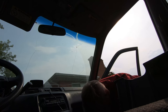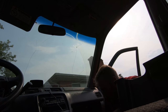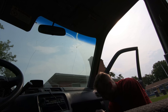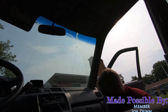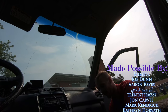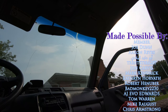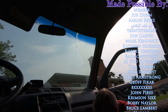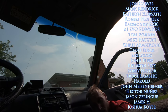That's playing way stronger. That just made me realize that's the best way to clean out the air filter housing area — just turn the blower motor on. That is definitely not a blower motor issue now. I think it's blowing dirt right into my eyes. Clogged up this new filter again. Let's clean this out and be done. That's pretty much the job well done. I've got a lot of junk to clean up now. I'm tired and thirsty and it's hot, but it went together well. No complaints — I don't think we have a blower motor issue after all. The filter was clogged bad, never occurred to me. I'll just return the blower motor to AutoZone tomorrow, didn't even open it.